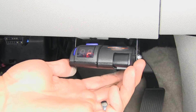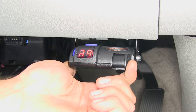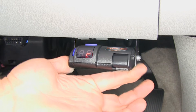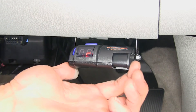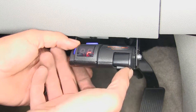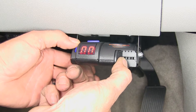A few quick things about it: we've got a slide manual override lever here. This helps us to apply brakes to our trailer only in emergency situations where we start getting some sway or we need to get it straightened back out. On the side we've got a dial that's going to allow us to adjust the amount of braking force that's being sent back to our trailer.